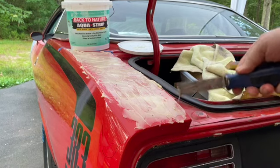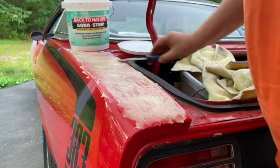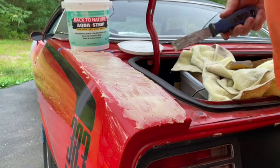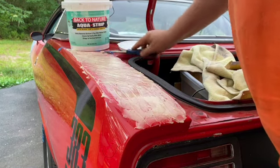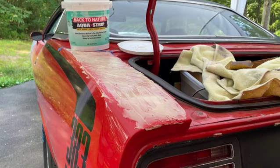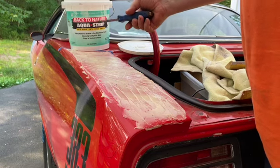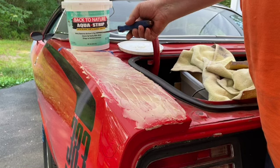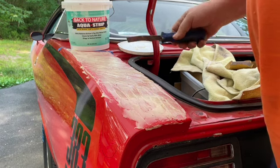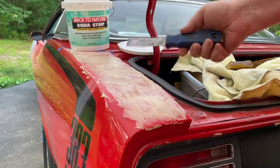It's put on at the same temperature as the other side because I'm doing it the same day. We'll let this sit 24 hours and then we'll see and compare the results to see which is better for your money. This is a stripper that takes time to work — unlike the aircraft stripper that's popular for stripping car paint, this usually takes about 24 up to 48 hours. Make sure you don't let the solution actually dry — you want it still wet when you remove it.